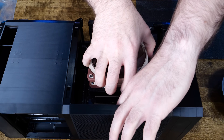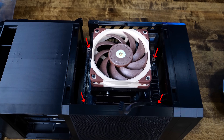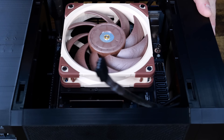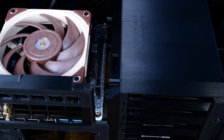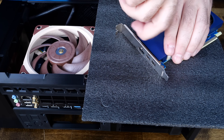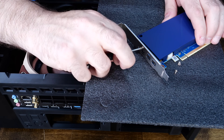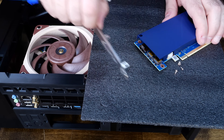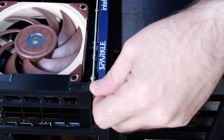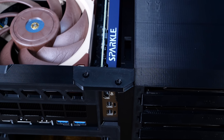Let's get the completed board mounted into our 3D printed case. The board is a pretty exacting fit, but getting it in was no different than any other typical small form factor build. The Mini ITX motherboard has four mounting holes to secure it — all four down, the board is secured. Now for the Sparkle A310 GPU: first we swap out the full-size mounting bracket for the included low-profile bracket. After removing the old bracket, installing the new one, and replacing the screws, installation into the case is a breeze. A 3D printed piece secures the top of the bracket and screws into the case.